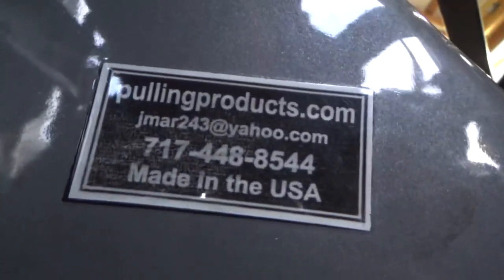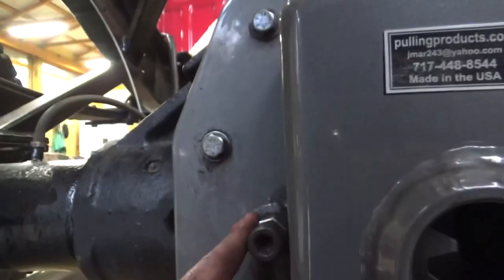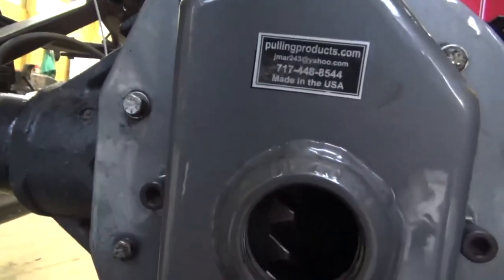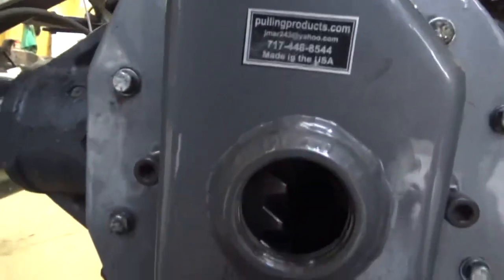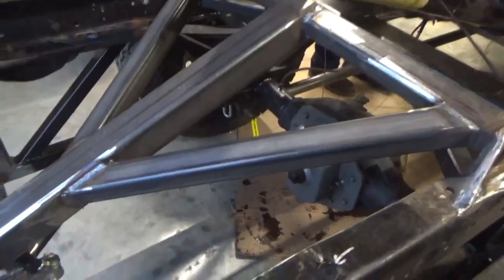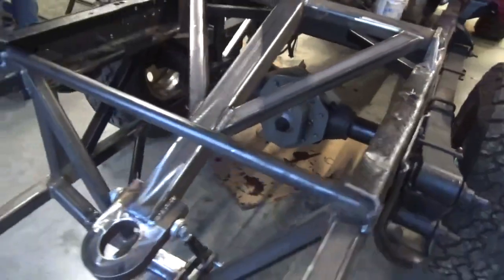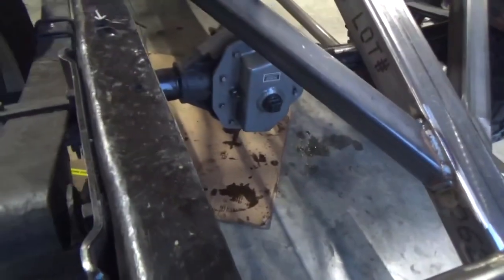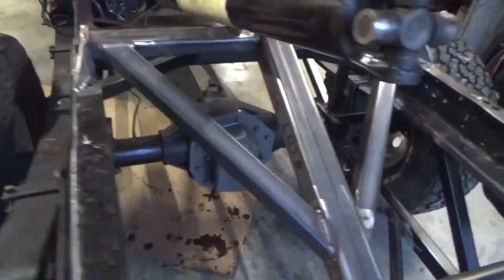Some people would ask about this. The jam nuts tightened up. We're good on our lash. Time to put some oil in — this job will be done. Gear's installed. I don't want to see them again for at least a year. Maybe more.